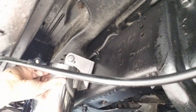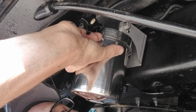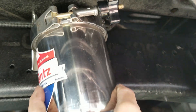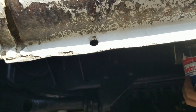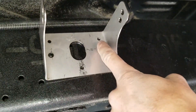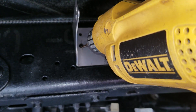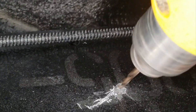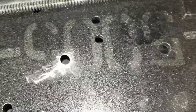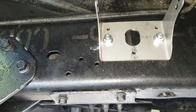I'm playing with positioning for the bypass filter and I think the best spot is on the driver's side, outside of the frame. It'll sit just under the driver's side on the outside of the frame, right behind the wheel. I was able to reuse an existing hole on the frame but needed to drill one more 5/16ths hole for a bolt. I ended up just over-drilling the hole slightly at an angle and it worked out just fine. After a couple of false starts — tough drilling at an angle — the bypass bracket is now mounted to the frame.